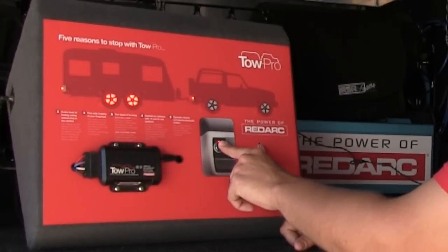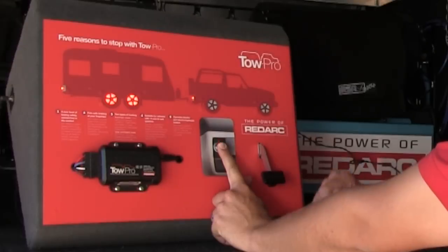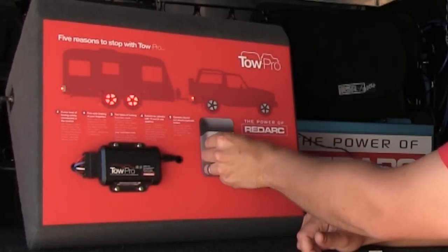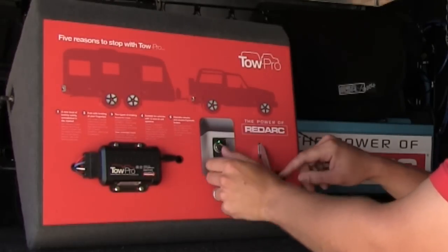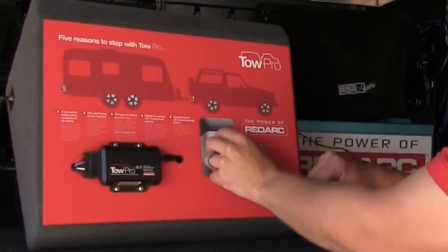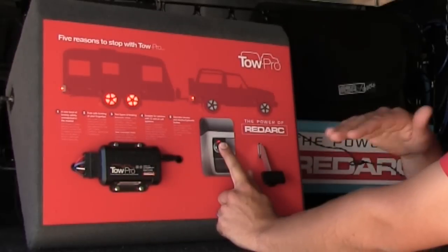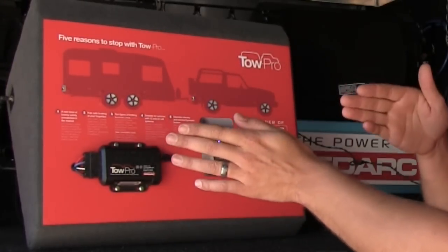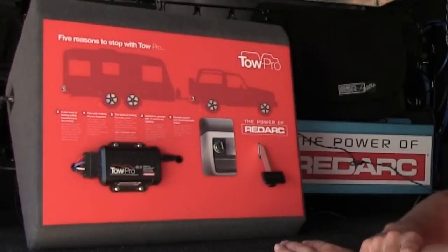Another feature is that you can actually push the knob itself to brake the trailer independent of the vehicle, and also bring on the vehicle and trailer brake lights. In user controlled mode, it comes on to the level that you have set. In automatic mode, if we return to it by setting to zero, foot on the brake and double tap, the override goes to a level that equates to soft braking on the trailer. The TowPro actually feels how hard the trailer is braking and regulates the amount of pressure to make sure the trailer is pulled straight behind the car if it gets a bit of sway — say if you've gone past a semi-trailer on the highway.